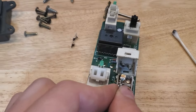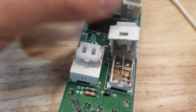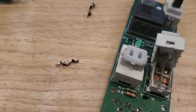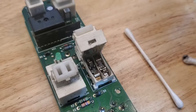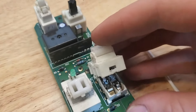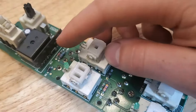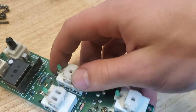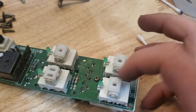Now I can go ahead and put it all back together. The sawhorses just go loosely in there, and when you toggle the buttons it just teeters on the sawhorses. Pay attention to how yours comes apart to make sure you reassemble it correctly, because every model is probably a little different. For reference, this is how they went back together on the 93 Lexus GS300. I'm now going to clip the plastic cover back closed. The only tricky thing is making sure the plastic cover lines up properly with the LED — you can just bend the LED legs back where they came from and test it with your finger.